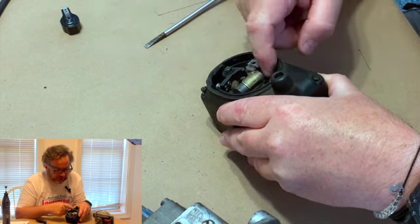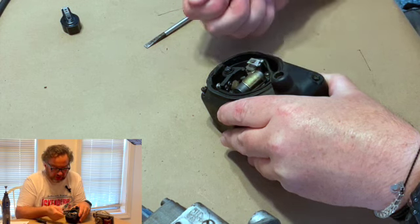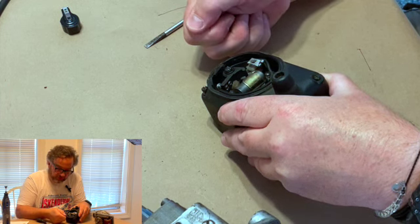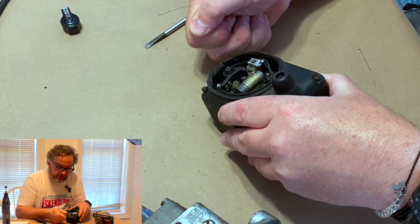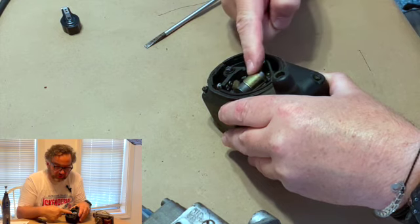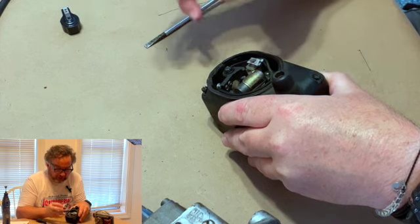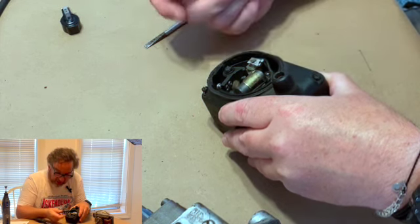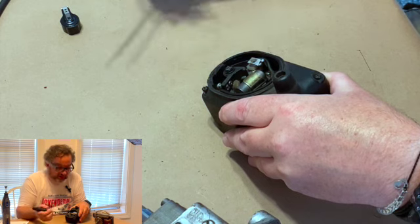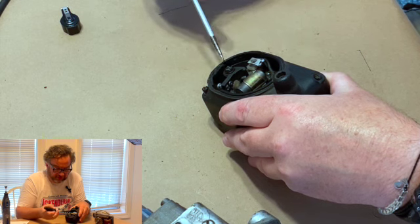So when it comes out of the condenser, it goes out to the spark plug. And what you've got is this just holds it back. Think about a water hose with your thumb over the end and it's just barely running. If you hold your thumb there long enough, it'll build up pressure. And when you let it go, it all comes out at once. That is what a condenser does. It condenses all the electricity that's floating around in here into one big charge, because it has to have enough and it has to have it quickly so it'll jump the air gap on your spark plug. So that's how they work, basically. It's just opening and closing, making and breaking the magnetic field.